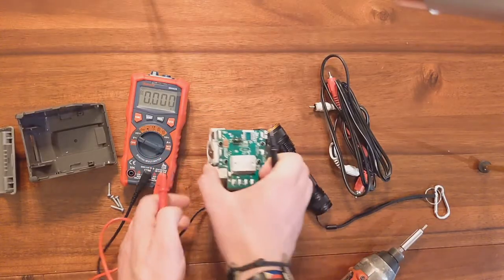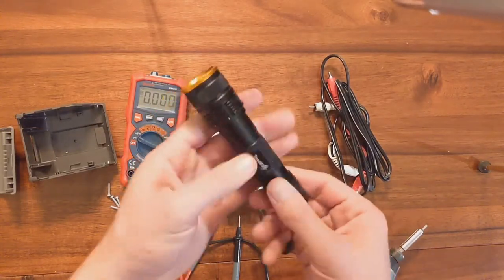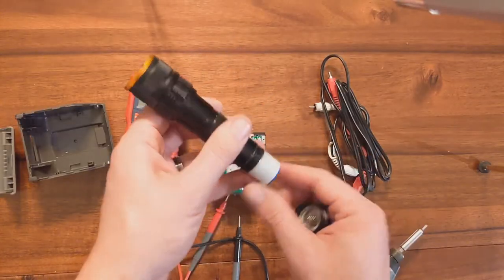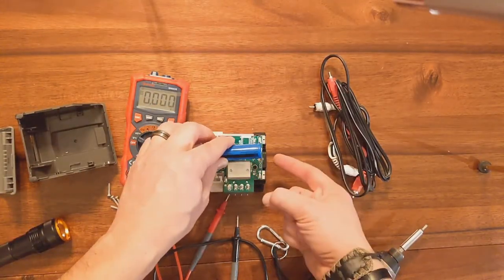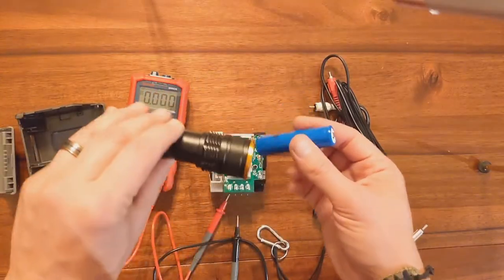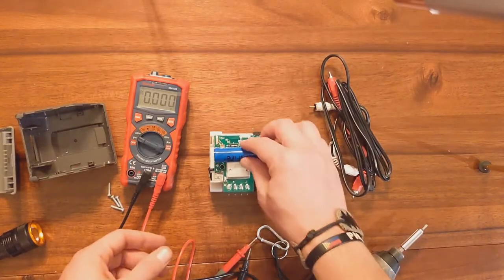So how do you fix it? Simple. All you gotta do is manually charge that one that's out of balance. And you can use another battery that's a match for it, or even another one that's part of the system that's all put together there. You just make sure you line up the positive with the positive, negative with the negative. A lot of batteries that are the same are used in flashlights, laser pointers, or like I said, just use other ones on the same system.